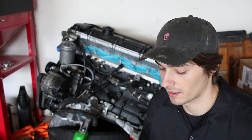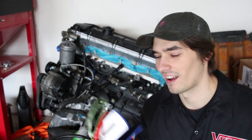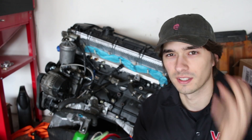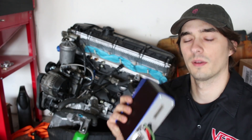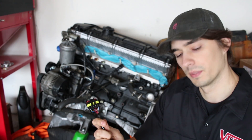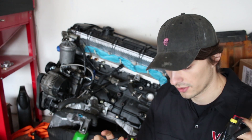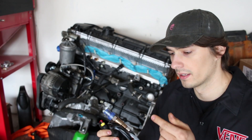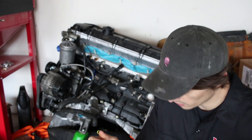One of these features is it has an exhaust gas temperature probe, which straight up blew my mind when I realized that. It's this guy right here. So you can get a little thermocouple that goes in your exhaust and it'll tell you the temperature of your exhaust gas. That is so awesome that I'm just tempted to do it — I don't know what the benefit is, I'm sure a tuner could tell me, but that's something I'm going to look into. It also comes with a built-in wideband — the system is actually built into the ECU, so you're not dealing with a separate wideband having them communicate. It's just a standard Bosch sensor that plugs into the harness. That's one pro right there.